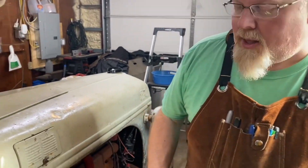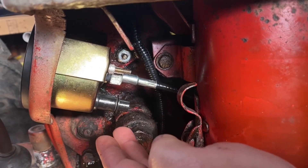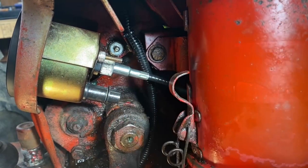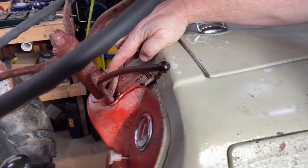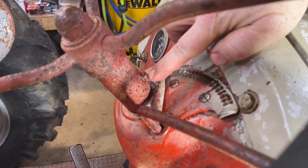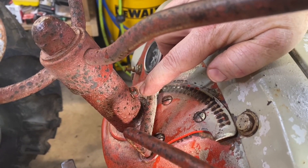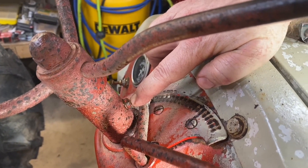So we got the bolt into place with the grease zerk on it — it's down there right by the proof meter. To make it easier it would probably be best to take the proof meter out, but I was able to work around it with the proof meter in place. Now we're going to fill it with the zero-aught grease, the corn head grease, using an air grease gun because it's going to take a lot of pumping to fill that gearbox up. On this 1952 Ford 8N — and I think some of the '51s had it also — this is the fill area. We're going to take that screw out so air can bleed out through there instead of rushing past the seals as grease is being put in.